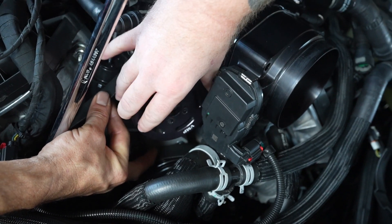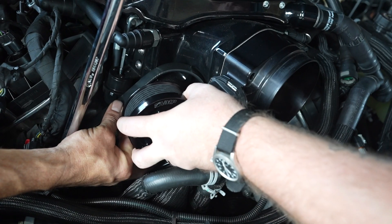I'll tell you something else we're doing. The fuel pump booster allows us to run E30 fuel. As you pulley down, you really need more octane than what 93 can provide. E30 is a quick and easy way to get that, and it's a little bit better than just boosting because of the way ethanol works.